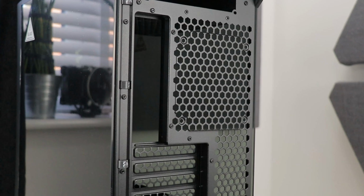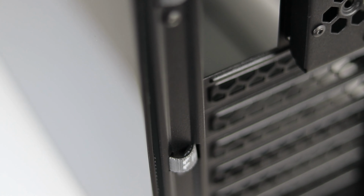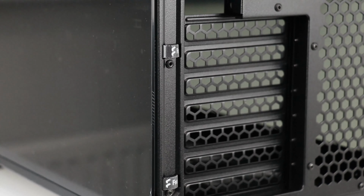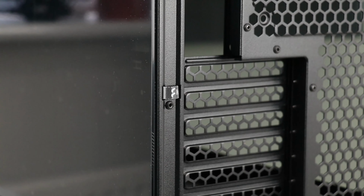The motherboard rear I/O and rear 120mm fan position are exactly where you'd expect them to be, stuck in the middle. It's worth noting, while we're here, that the rear I/O and the PCI Express slots are depressed. Not in the same way I feel about the cable management situation, rather they're depressed in a recessed fashion from the rear face by a good 15mm. I think this is mainly to reduce the stress on as many of your cables trying to make the turn from your motherboard's rear I/O to utilise the external cable management straps. This works really well for desktops, but I'm not buying it for many other setups like floor mounted ones.